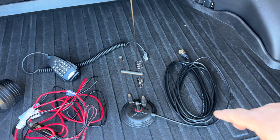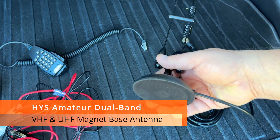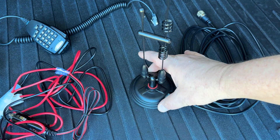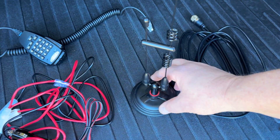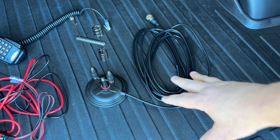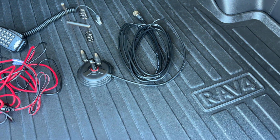As far as the antenna goes, here you go — UHF, VHF combo antenna, mag mount. I like a mag mount because I don't like to drill holes in the vehicle. It's got a nice rubbery base to it, about three inches wide. If you're going 90 miles down the road — although you shouldn't be — it's not going to blow off. It's got a nice length of cord here. This may be enough for some vehicles; some vehicles you'll have to put a barrel in the middle and add a piece of cable to get all the way to the front of the vehicle.